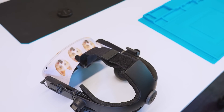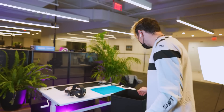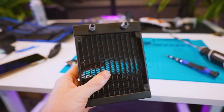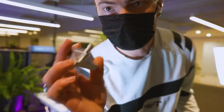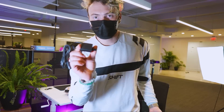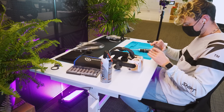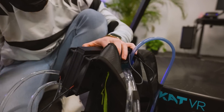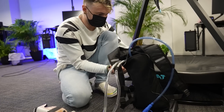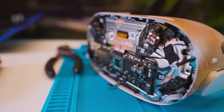So let's get down to it — we've got some Quest 2 to cool. I am officially naming this the Doge Quest, for obvious reasons. The components are super simple and really cheap: a 120mm radiator for around $15, a small aluminium waterblock for the CPU, some watercooling tubing, a submersible water pump, and a couple of USB-powered fans along with a battery bank. All in all, the parts will run you around $50. The idea: block goes on the CPU, radiator goes on a camelback, and the submersible pump goes inside the water reservoir — which is the camelback.